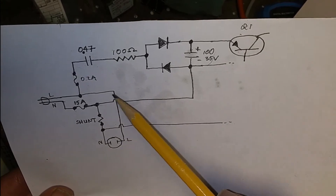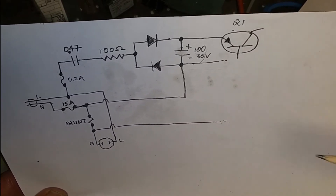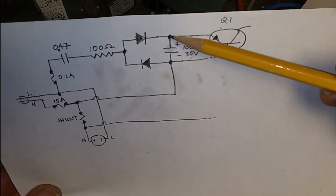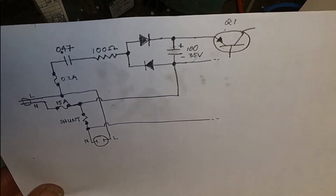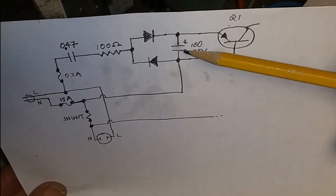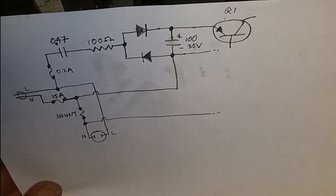So again, it looks like the problem was just with this voltage drop capacitor. If you have one of these and have trouble with it, probably the first thing to do is check the supply voltage. You can measure that by measuring the voltage between these two diodes, because that's very accessible when you take the case apart and you don't have to remove the circuit board. And apparently that's supposed to be about 14 volts. If it isn't, you can just go ahead and troubleshoot from there.